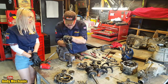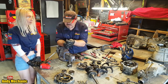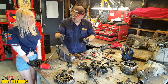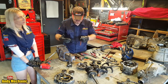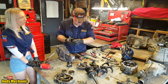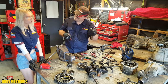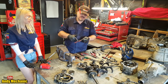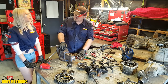Okay, and the ball bearings, in conjunction with the springs. Remember, there were no springs being used with the interlocks, but we use springs with the ball bearings, and that's part of the detent system. So the detent system makes sure that the selector shaft moves all the way, rather than just part way, because it has a positive feel to it and it locates correctly, so that the dog teeth and the collar engage fully. If it was only half engaged, it could slip. And it also gives a feel for the driver: in the car, it's first gear, click, and the driver knows it's in gear because he's felt it click into place. So that's your detent mechanism. And there are videos on the channel covering interlock and detent mechanisms in a little bit more detail in a much shorter video.